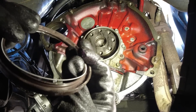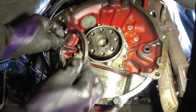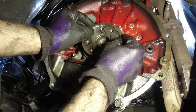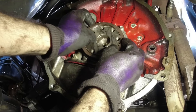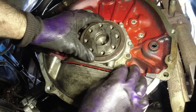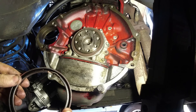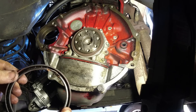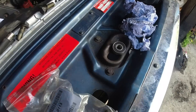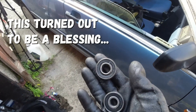The metal ring has already come out of it. It's probably going to be tricky. I'd like to use the old seal to help me but it's in such bad shape I don't know if it's a good idea. It's going in a bit too easy - this doesn't happen very often, but I've got the wrong pilot bearing. It's too small.